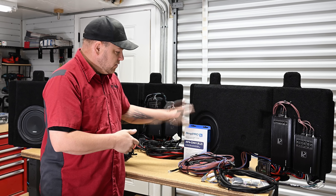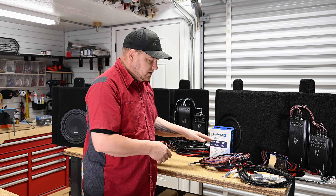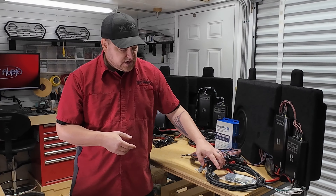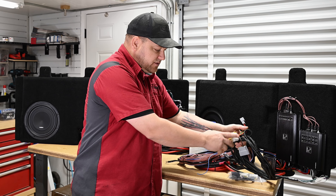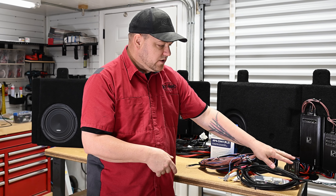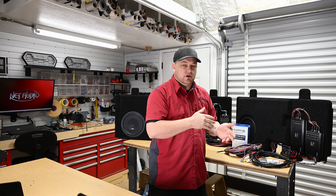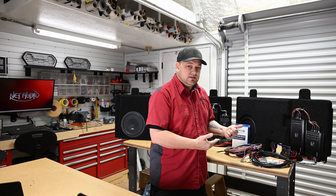In this case we're doing the Pack Amp Pro — we've already got our RCAs and everything pre-wired on that. You run the RCAs down the passenger side so they stay away from your power wire and your return run. We've modified things and are using our amplifier bypass harness instead of our ANC harness — this still runs up the driver's side and plugs in under the driver's seat. We also added bass blockers for a little extra protection for the three-and-a-half inch speakers installed in the dash locations. This is pre-wired and ready to go for running the four doors and the dash.